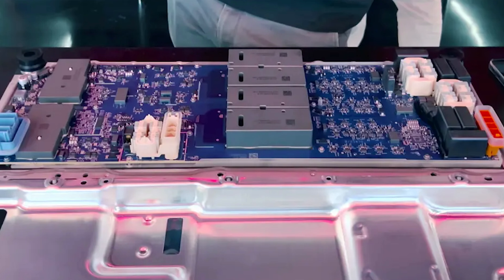It's one board that sits deep down in the vehicle, underneath the bed of the truck, underneath the air compressor and all of that. It's a board about so long and so wide — a big blue board — and it's called the PCS. Most EVs have a PCS or some version thereof. In the Cybertruck it's really critical because of the type of electrical systems on board. The PCS does a couple of very important things: number one, it changes AC to DC in the truck and vice versa. It's bi-directional. This is what allows you to charge at home from an AC adapter into a DC battery, and also allows the Cybertruck, as a DC power source, to back-feed the home with AC current coming out the cord.